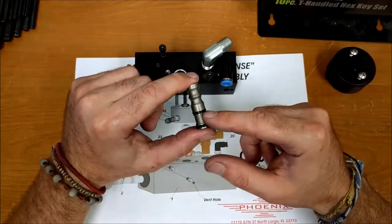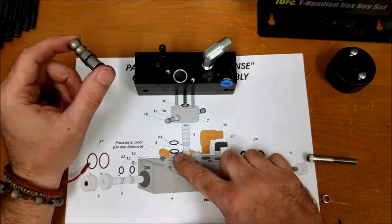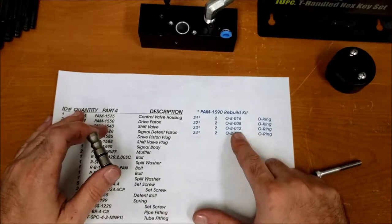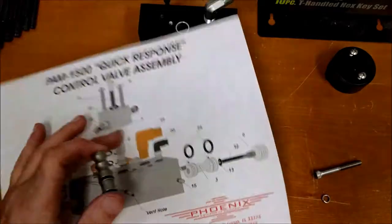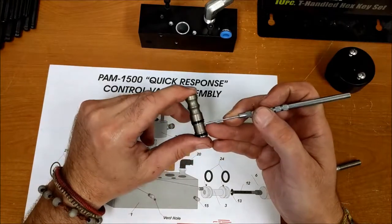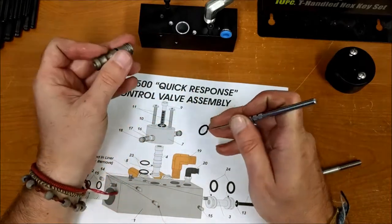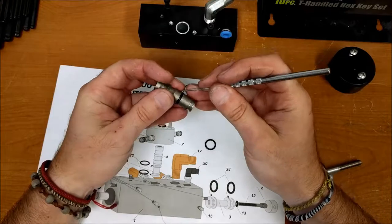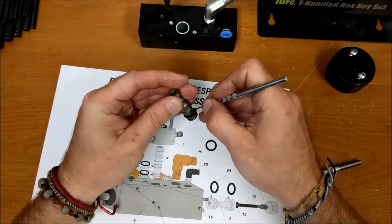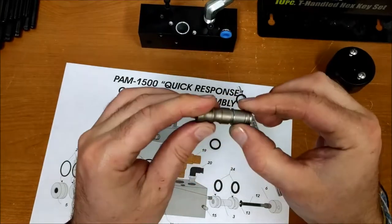This is the shift rod. You've got two o-rings on the top — number 23 on the back, or OB-12s — you've got two of them and we're going to be changing those out. I recommend getting a pick or anything you can use to get those o-rings off; they're usually pretty easy, just pop them right out. Once you pop those off, clean this cylinder with some water and finish off with acetone, wipe it all down real good, make sure all the grooves are nice and clean.